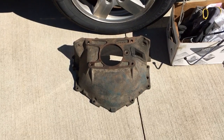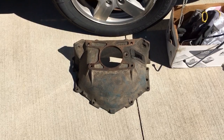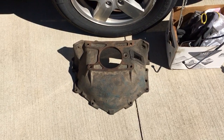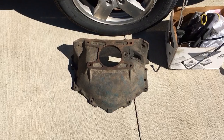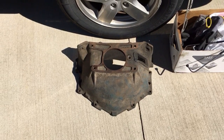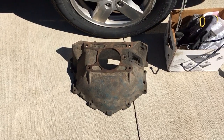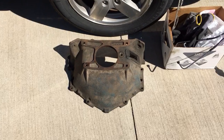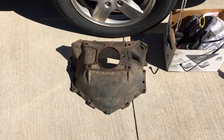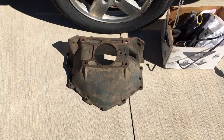But it was absolutely trying to glow all eight header tubes on initial fire-up. We battled raising the fuel pressure to try to fix that while getting the timing dialed in, then got the dual exhaust put on it, which totally made it run rich. So then I had to go back in and lower the fuel pressure in the throttle body — it's just crazy.